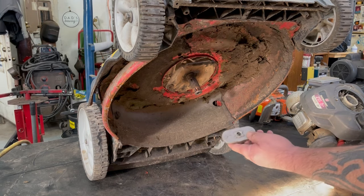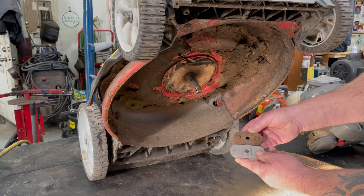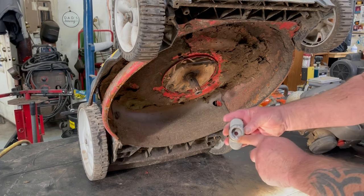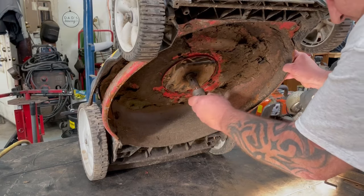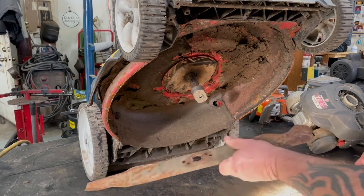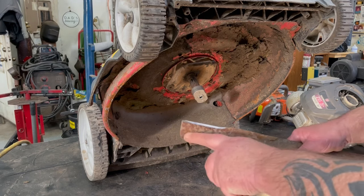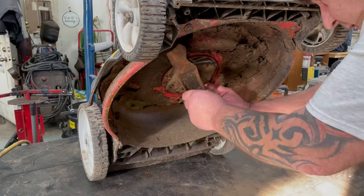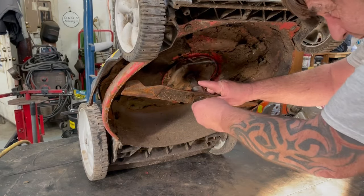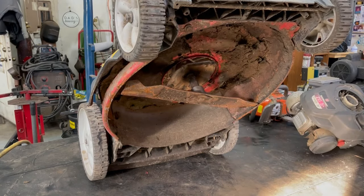Now I need to find a hub to fit that blade. Here's an MTD hub with a star in the center. I don't know why they had that wrong hub on there - maybe they had something break and found a different one somewhere else. This is what you want on there - it has a pre-made keyway in there. I'm going to go ahead and sharpen this blade here real quick before I put it on - put a nice edge on there just like a brand new blade. If your wingtips are getting worn out, replace them. Wings always up when you put the blade on. That's a 5/8, so I'll grab the 5/8 bolt.